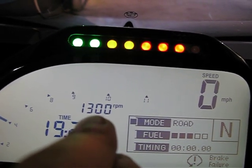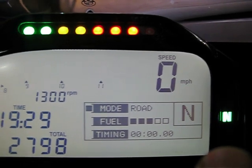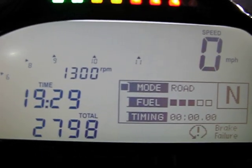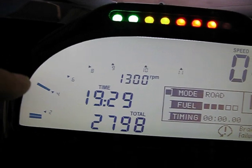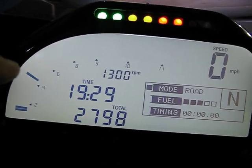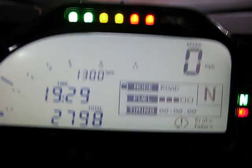Starting the bike — the warm-up RPM is 1,300. The ABS light is blinking because the bike hasn't moved about three feet or one meter; the ABS will sync and the lights will go away. Keep an eye on these startup lights and the suggested rev limiter as the bike warms up — the lights will diminish and the rev will go up gradually. The bike will not stop you; it's just a suggestion to keep the rev below this number. We've already lost one light and it has gone over 4,000.